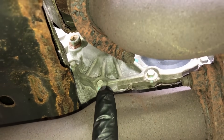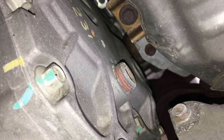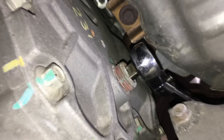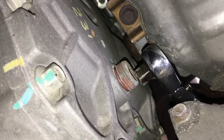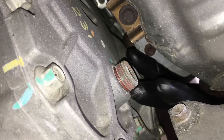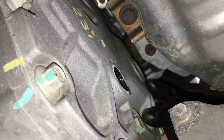It's not too hard of a job — it's one quart of fluid or less, not too expensive. Here's a good view of the PTU from the top. From below, that's the drain plug right there which is also the fill plug. What you want to use is a regular 3/8 ratchet — it shouldn't be torqued down too much. Get up in here, break torque on it, and get it out of there. Once it's loose enough, you can generally reach up and just spin it off.